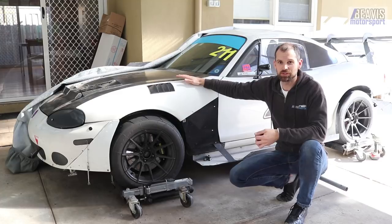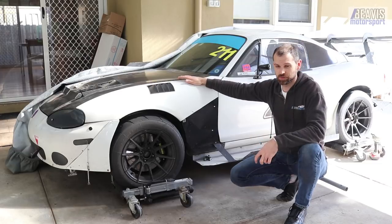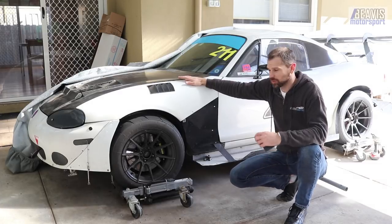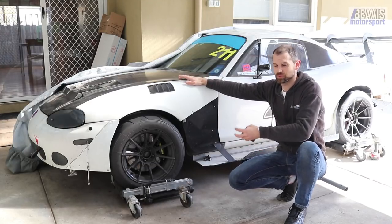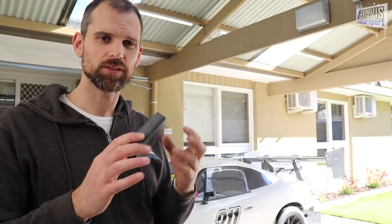So what are the fixes? You can go super crazy high-end — race cars or top-end performance cars might run rod ends for bushes, effectively deleting a bush completely, resulting in a solid-mounted suspension setup. There are some negatives there; ride and comfort is probably the most obvious one. If you don't want solid rod end mounts, and you don't want rubber which is soft and squishy, and you don't want poly which sticks — well, the answer is this stuff. This is acetal, aka polyoxymethylene, or as most people call it, Delrin. It's a plastic.